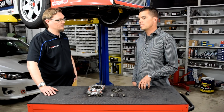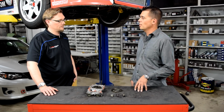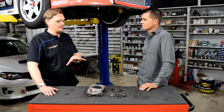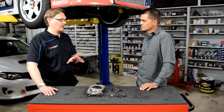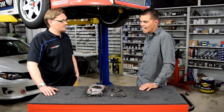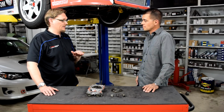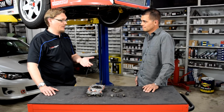So I think an important piece for me, kind of just understanding my own environment, is that I had an oil pressure gauge and an oil temperature gauge. And those are the two, if you're going to start looking at anything to do with the oiling system, those are the two basic pieces of information that you have to have. You have to have both of those, and they're just fantastic on just giving you a vision of what's going on. And to be fair, when you put those on, getting a baseline, knowing where you're starting, that's also hugely helpful.